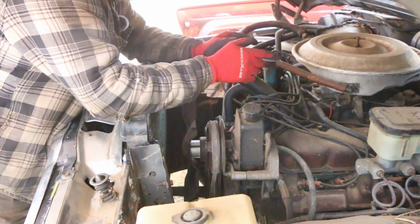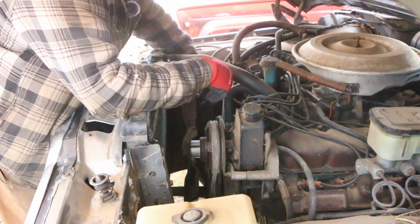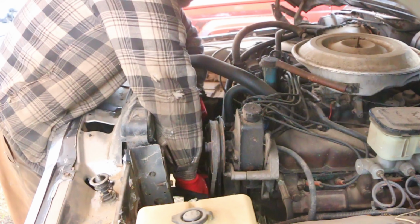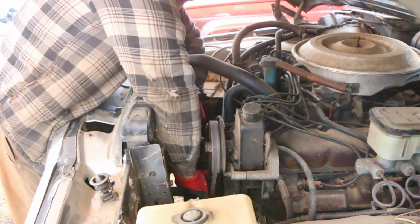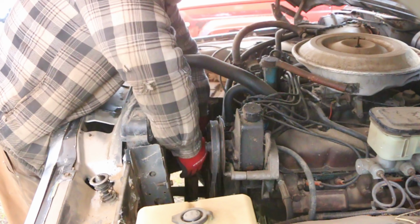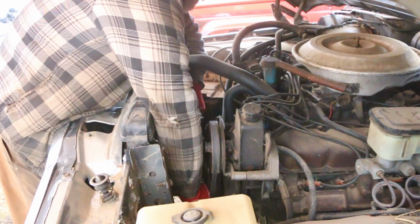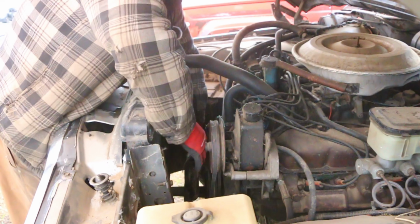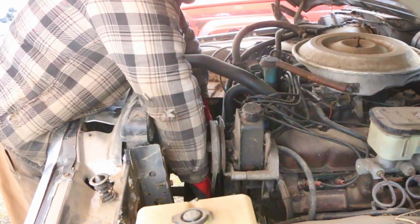All right, step one for this rig, we're going to see if the engine actually turns over by hand. Oh, it does. I wonder, it's got a little bit of compression in it. A little bit of grass we don't need. Yeah, I mean, it winds over. I wish it had a little more resistance, so it could be a 100% oil burner. It has sat for, let me think, can't quite verify it, but I want to say 20 years.